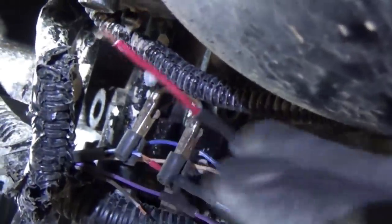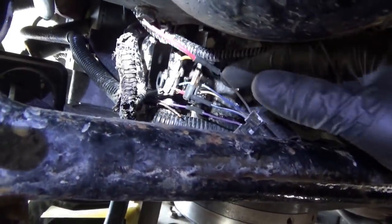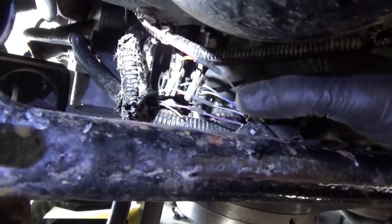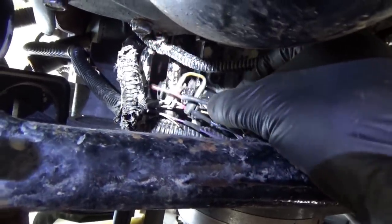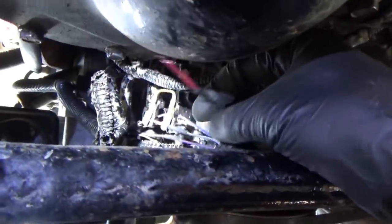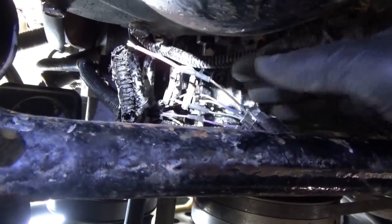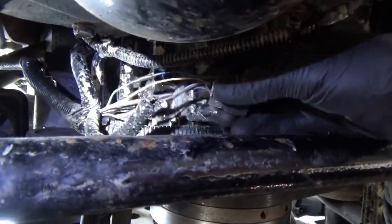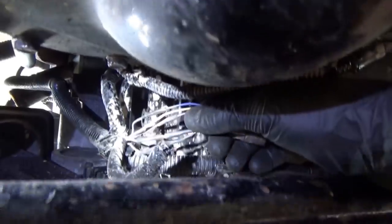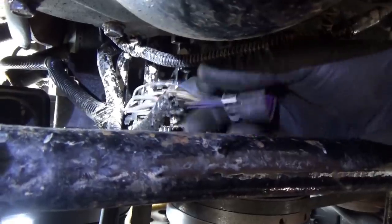The trick for these extensions is you want all the wires to be approximately the same length so the harness doesn't get funky, and all the wires shouldn't have any pull on them if they're long enough. I cut off and restripped this extension, and we'll do the same for the second one. The purple wire I just soldered back together since there wasn't much length missing. That should be it for the repair — we'll wrap it up and make it look nice. We've got three wires soldered: two with extensions and a little electrical tape on the blue one. Wrap it up and plug it back in.